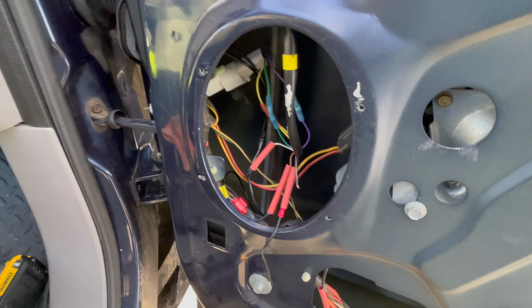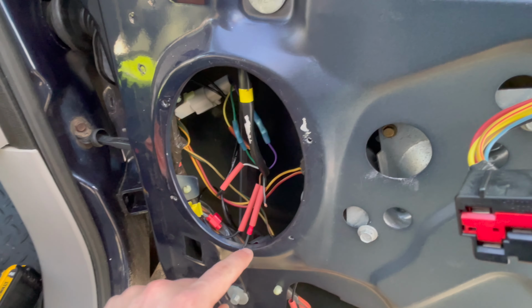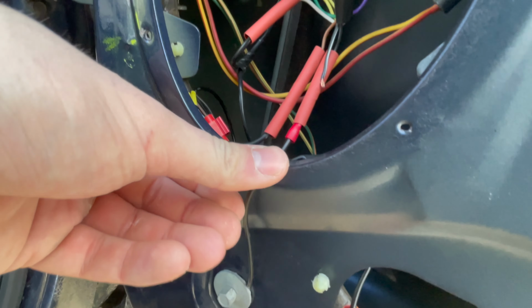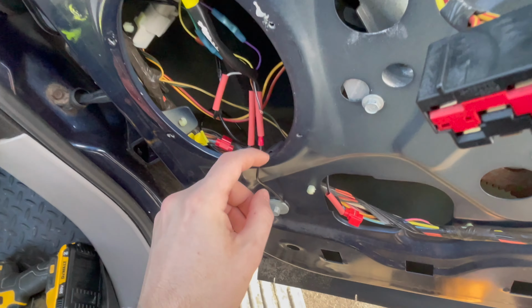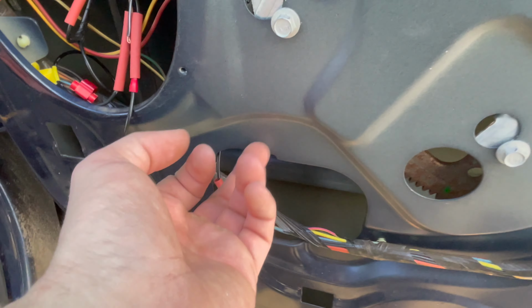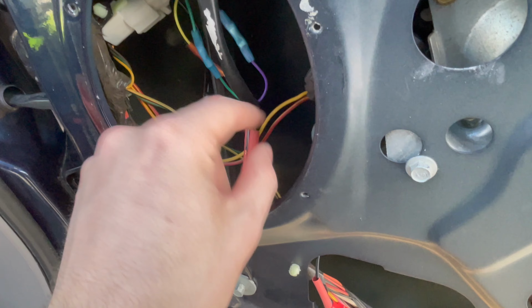We had a good connection going, and then I forgot that there's a speaker that goes here, and I don't want to pinch the wire in here, and I don't think it would fit in there anyways when the speaker's in. So where we're at now is I have to cut this connection, unfortunately, run the ground wire up behind here, up under here, and then attach it back to the black wire, which again we know is our ground.